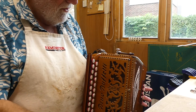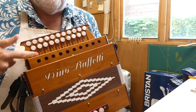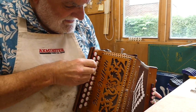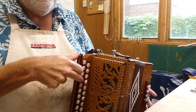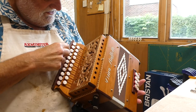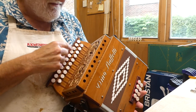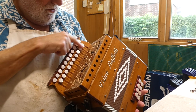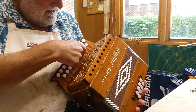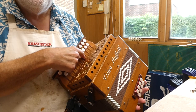Good afternoon. Thought we'd do a quick video about stuck keys on these sort of open keyboards. This one's got an intermittently sticky key, which of course won't stick now. The customer's tried some pencil lead down in the mechanism which has not made any difference. So what I'm going to do is pull the first seven or eight keys out and just clean up inside the groove and down the side of them.